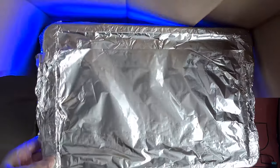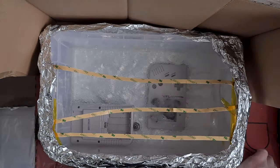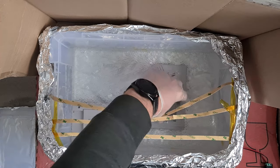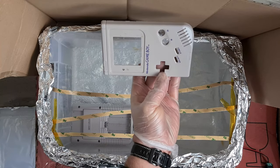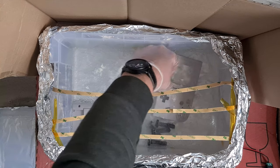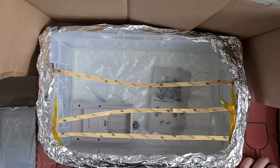Put the shell in the container. This process will take up to 48 hours depending on how yellowed it is. The back half and the battery cover were not that bad, but the front I left in for 48 hours — that's a long wait. If it's not that yellowed it will be fine in around 24 hours, and you can check on it meanwhile. At 30 hours in, the difference is uncanny to be honest — it looks really amazing already, just needs a bit more time in the bath.